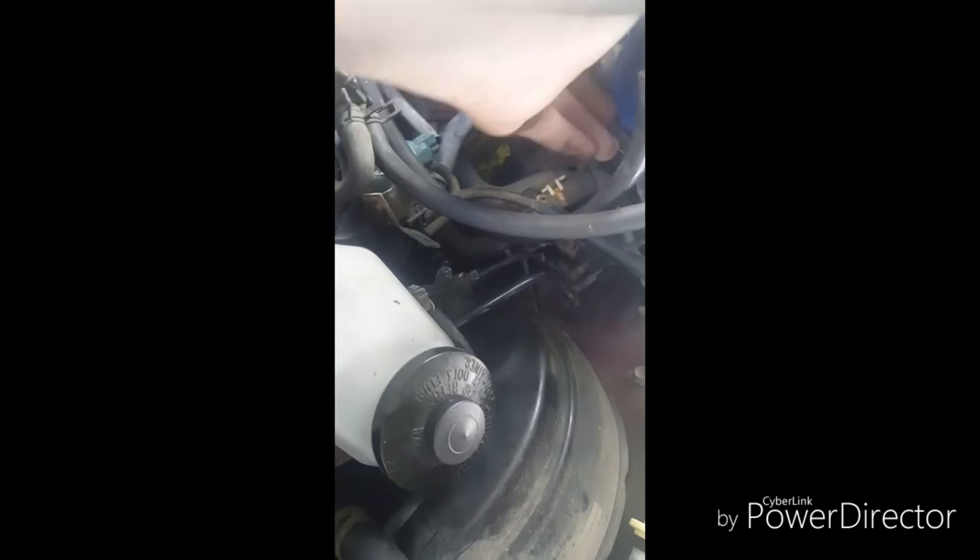You're also going to need the other clamp and you're going to do the same thing. The knuckle side of the intake goes to the engine — this side goes to the engine. This is the other side, because your sensor, your intake air temp sensor, which was removed from the housing, goes in there. We basically just slide this up after we put the hose clamp on, because that's going to be a pain if we don't have that on there. Slide that on — there we go. So that's on; go ahead and slide our intake up in here.